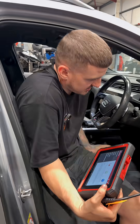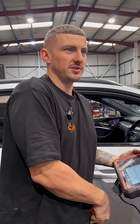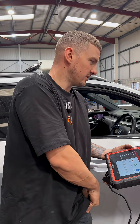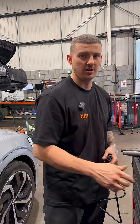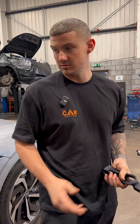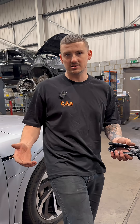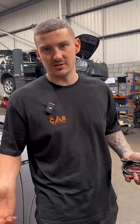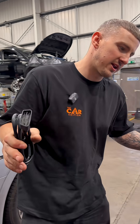Well, that is an experience for us and for you guys on how to service an Audi e-tron. For everyone panicking — oh, you need to be electric vehicle qualified, you need to do your training — one, I have done. Second of all, that's only if you're really working on anything high voltage. This is just a service, it's basically a check-over, what the main dealers call a kick and spit. You're checking everything but you're not actually replacing anything to do with the battery voltage system. You don't need any special equipment because you are not touching anything high voltage. I've changed the pollen filter and drained some coolant. So don't panic — I am qualified.